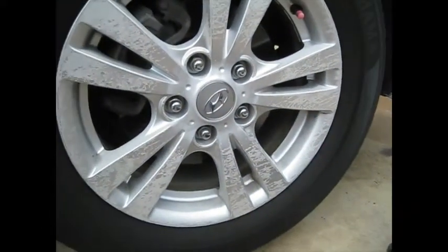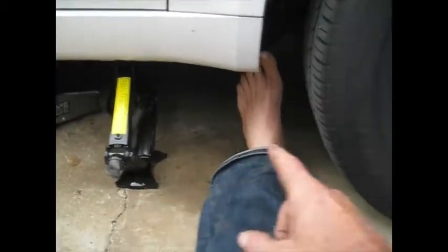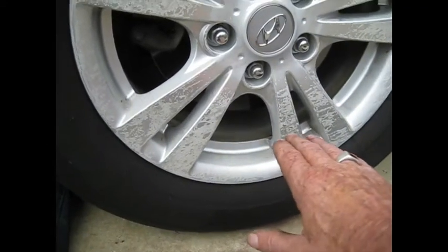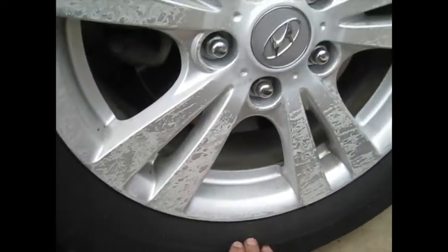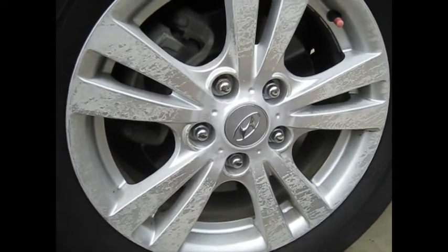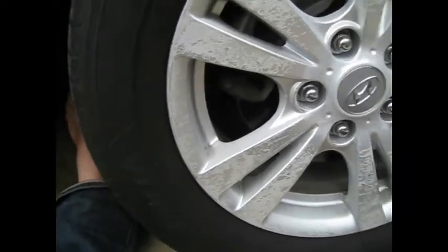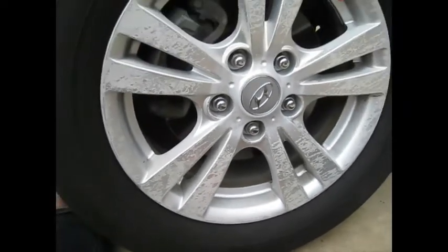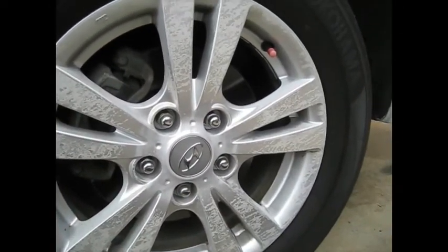Now, before you go too much further, you also got to remember this tyre's probably going to be dead flat. So that jack's going to be a lot lower down before it goes under, and then you've got to crank it all the way up. When your tyre's flat, it'll clear the ground rather quickly. Before you've cleared the ground with your tyre — this is a front wheel drive, so it's not so bad. If you're in park, this tyre won't spin. But if your back tyre is flat, the best thing to do is lift it till before it's off the ground, and then crack the wheel nuts.